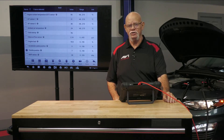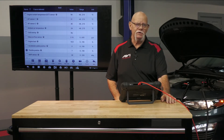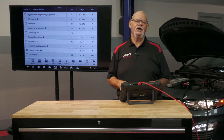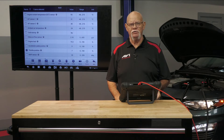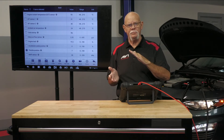If the vehicle is naturally aspirated — no turbocharger — then we look at our MAP sensor range from 0 to 100. If we were looking at inches of mercury, we would only have a number scale of 0 to 30, and out of that we'd only really use 0 to 21. A good idle is 21 inches of vacuum. Wide open throttle is 0 inches of vacuum. So your scale is 0 to 21 — 21 numbers.